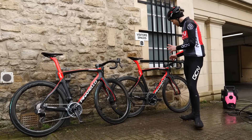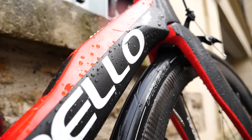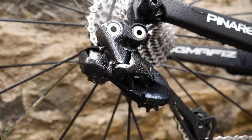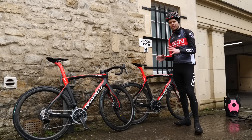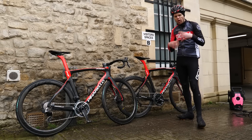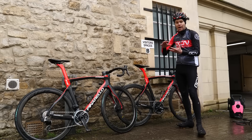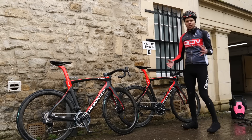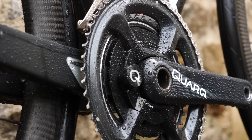Having washed the two bikes, the surface treatment on this is really evident. The beading — you can just see all those little water droplets suggesting there is a really hydrophobic surface coating on there. It really is cool to see. Admittedly, the dirt kind of just dropped off both of them, and there still is a bit of dirt residue left on this one and there isn't quite the beading, suggesting it's not quite as efficient. But I don't think this test is fully representative of real world conditions — mud is pretty water soluble, it just drops off with water. The things that really get your bike dirty are oils and greases from the road and drivetrain, which create smears and stains that are quite hard to remove without a degreaser. That is where I think this kind of coating will be far more effective.